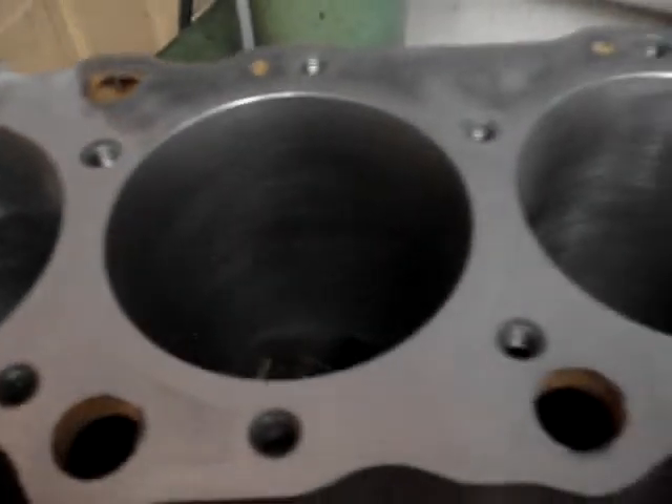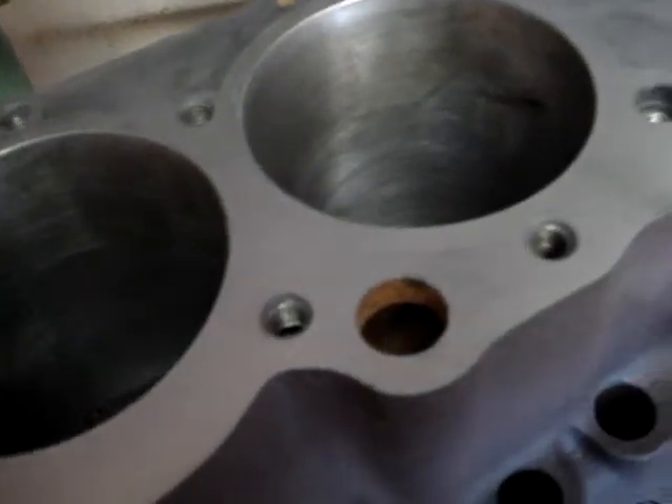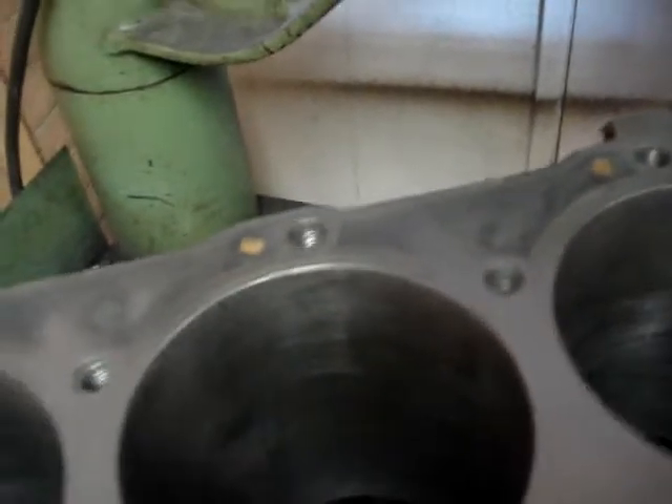It's as if there's chattering going on, or the block is wavy, getting low and high spots. It's interesting that the straight edge didn't pull any warpage at all. The gasket will actually absorb some of this — in fact, the gasket probably would have absorbed all of it. But on a performance build, we don't really want the gasket absorbing distortion; we want the block perfect. I don't care what that straight edge says — you need to get that block milled if you're doing any kind of performance build.